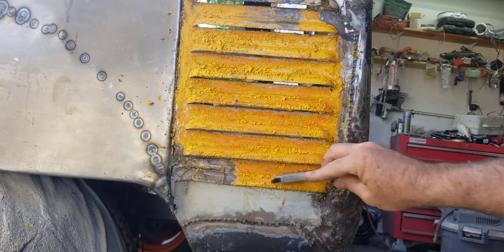Another layer — let's throw some more stripper on. What I could do right now is rinse this off with water and use that twisted wire brush. Make sure it's a twisted wire brush — you can get those at Harbor Freight, they sell a little kit with a bunch of different wire brushes. Those twisted wire brushes, if you use them on a grinder or sander, can take off the stripper or strip it down to bare metal and kind of polish the metal very quickly. At that point you don't really need to sand — just use that and it'll take it right to metal.